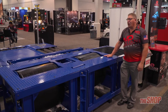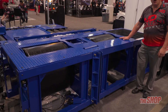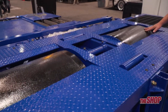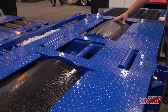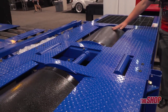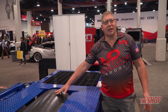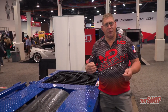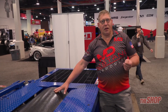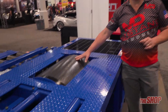This model is our very popular two-wheel drive dynamometer — this is our MD 1100 Series. This one is rated for 3,000 horsepower at the wheels and 250 miles per hour. You could do true quarter-mile drag racing on this dyno, trans brake launches, all your shifts just like a drag strip, and the time slip that prints out from our Whole Shot software will mimic the actual drag strip's time slip within one-tenth of a second.